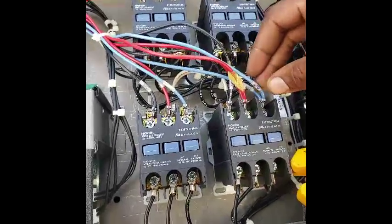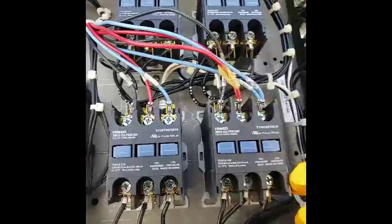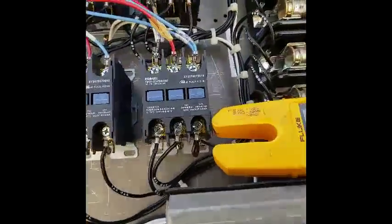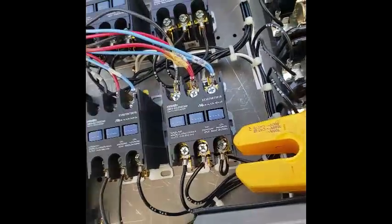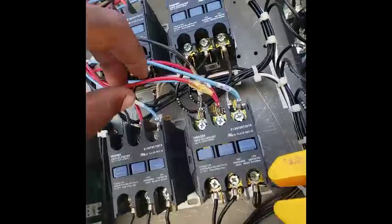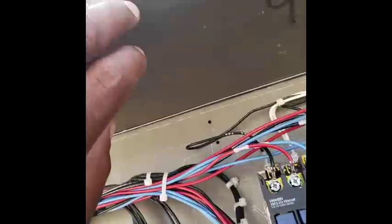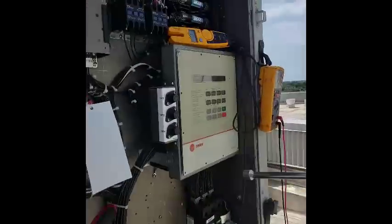So I'm gonna take these off and see if both of them are grounded or just one. When I know I got a motor grounded, I'm gonna actually check it at the motor. Because you can have one of these wires — if it's cut and the copper is showing and it's touching this chassis — that can blow them fuses also.